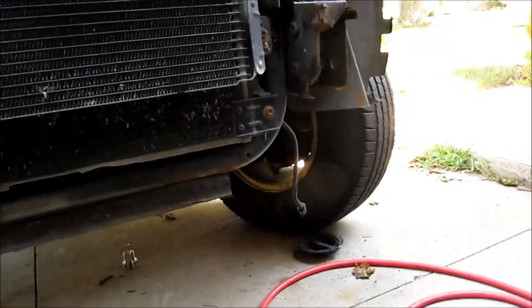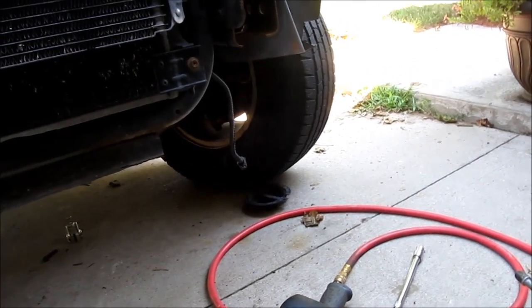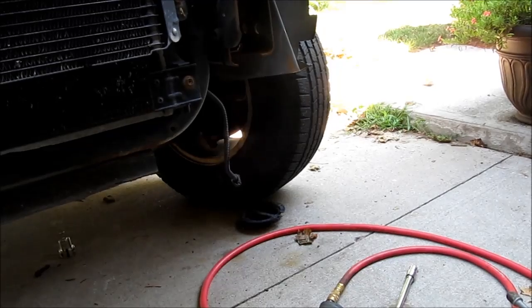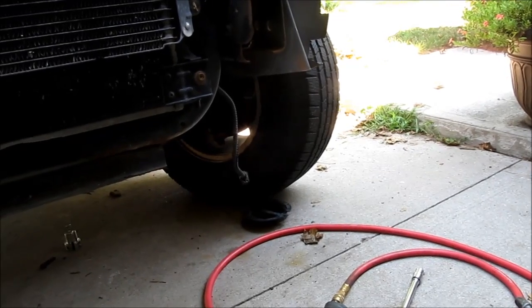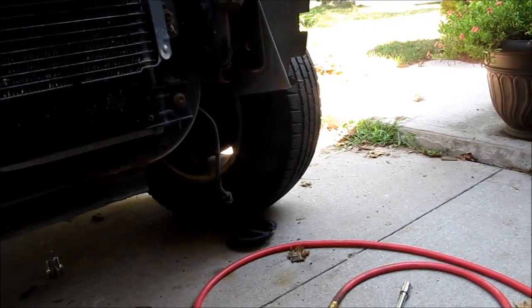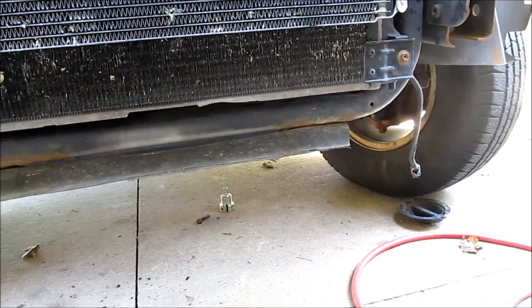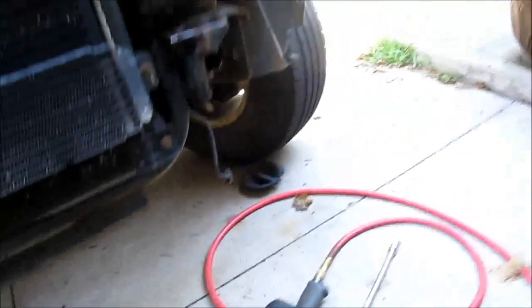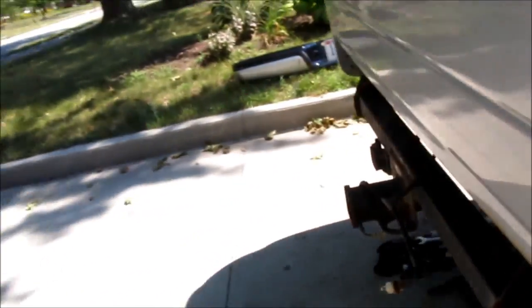Once I had the lower steering bolt out and the top one loose, like the instructions say, then I disconnected the batteries and pulled the airbag fuses. Not that I really think I had to on my model, because I don't have to deal with anything inside, no shifter linkage, because it's an automatic with an electronic transfer case. But I did it anyway. So the next thing,